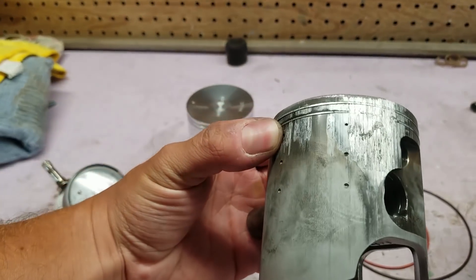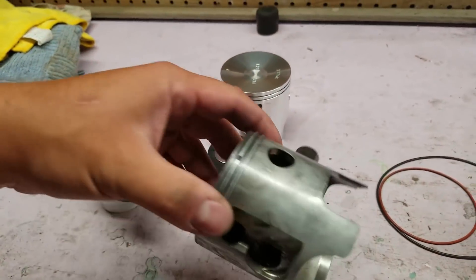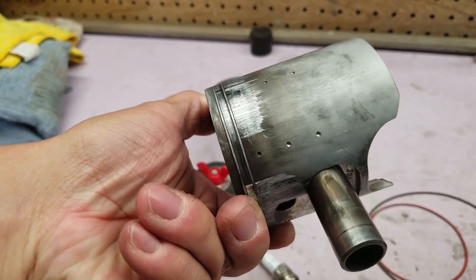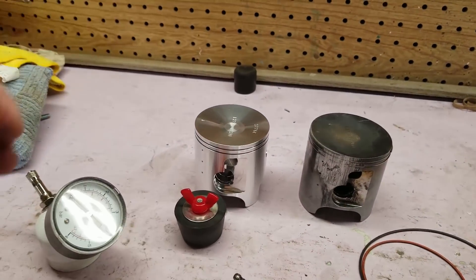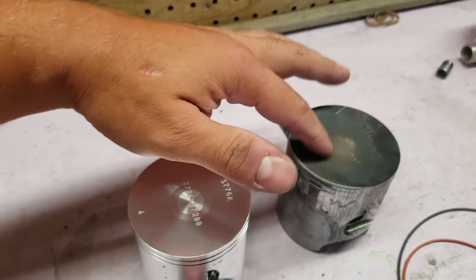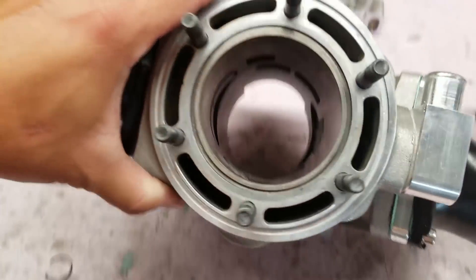It's really not horrible — with the exception of the two areas that really got fried, the rest of the piston is not in terrible shape. The skirts are actually pretty decent. There's just those two spots in the front that are hammered, and the rings in the back move, but up front you could probably dig those out — obviously we're not doing that. You can see the wear; it's just a little bit of a rounded edge, but the top of the piston is not bad. If you took some steel wool and cleaned that up it would actually look pretty decent. You can see the head is nice and clean, and I'll give you guys a look in this cylinder too — it's really not that bad.